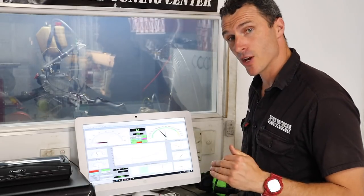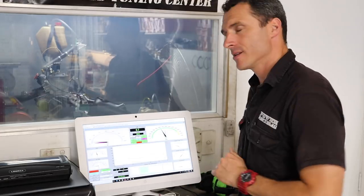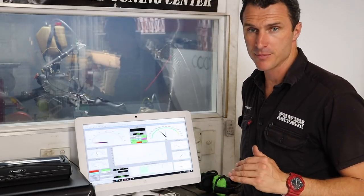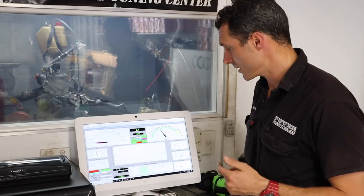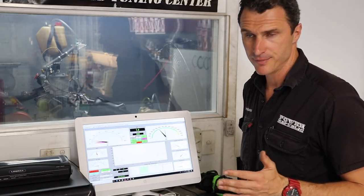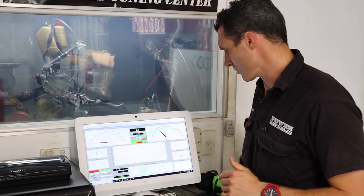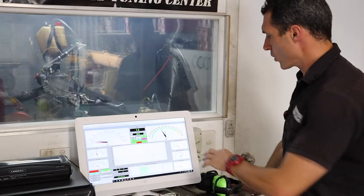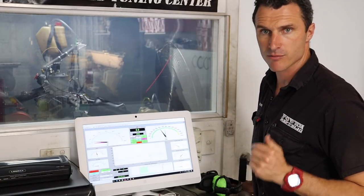This thing's making 15 horsepower — it's just at 7,500 RPM, which is probably the minimum we're going to see on a track. The power valve is supposed to open at 10,000, so we'll be able to see that when we're doing the power runs. We just need to get the water temperature up to about 60 degrees and then this engine's running in through its last running-in procedure.